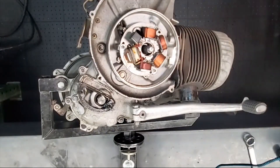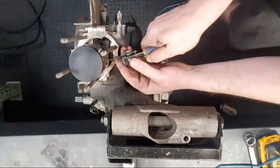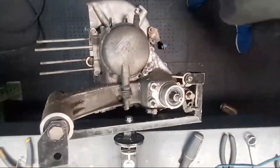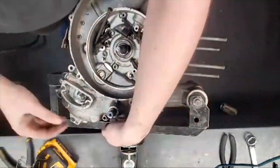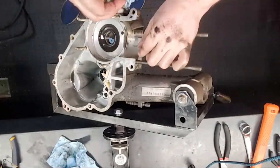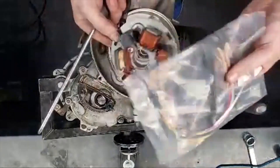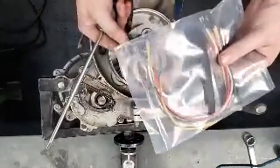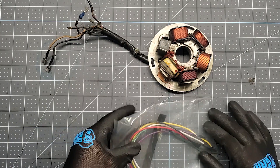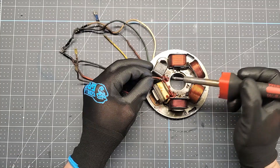The rest of the teardown didn't reveal much that was busted, so we're going to keep the original gearbox and the original gearing except for a shorter fourth. But we will be replacing all the internals like bearing seals, gaskets, and rubber parts just to make sure you're basically getting a new engine when this is done. The stator that came with it was completely busted so I'm going to use one of my stator rewiring kits to rewire it and give it some fresh wires. I have made a video on this kit that you can find in the description or on my channel.